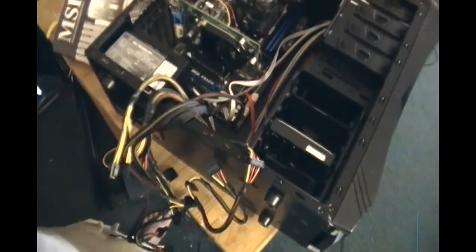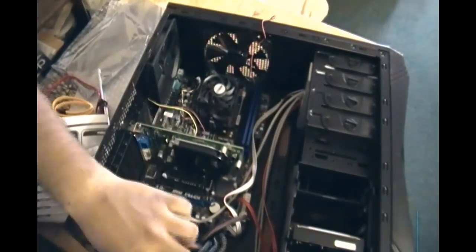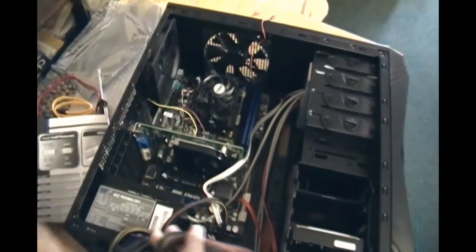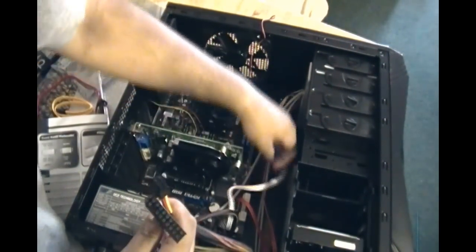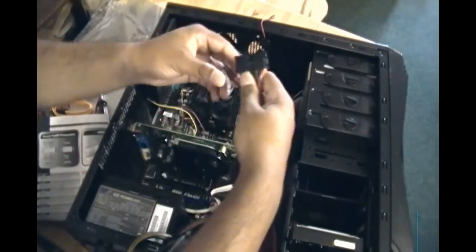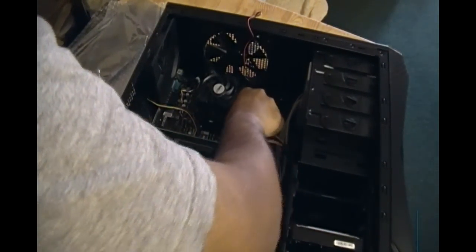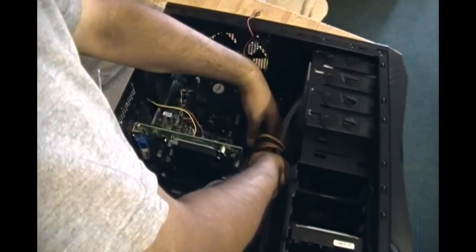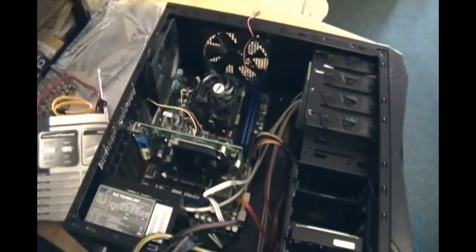You can just move the wire over — you don't have to pretty it up yet, you can do that later on. Now that we have the LED lights and everything connected, we're going to have to install and connect the main power cable. From the power supply unit, it's the big thick wire — the thickest wire there. You have 24 connectors here, it's 20 plus 4. They go where the biggest slot in the motherboard is, up here. Make sure you slide it in — there's a way to put it in. It's connected properly; it won't come out, there's a clip there. And there you have power to the motherboard.